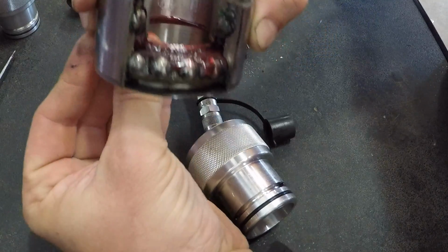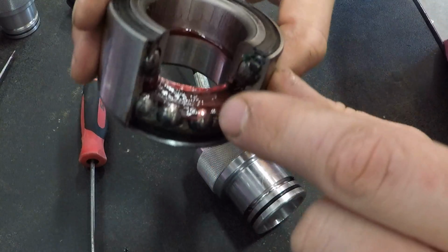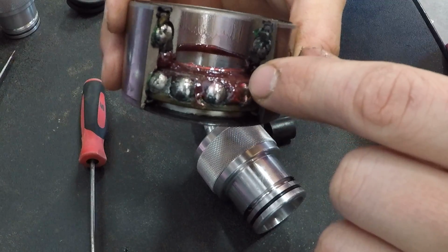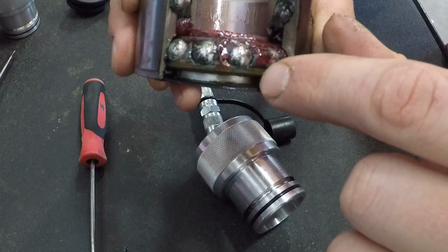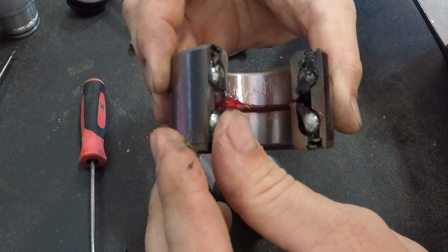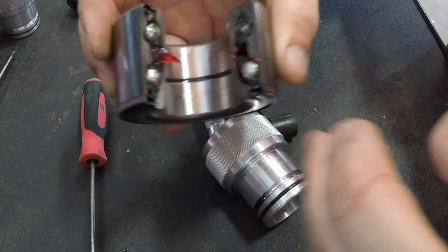That's what happens. All of the grease is in the center cavity and it's starting to go actually past the ball bearing. So in a normal bearing that hasn't been cut away, where the grease is right here that we've not touched, the grease will go through this cavity over and then come out the seal. We'll just push that back down out of the way, and that's exactly what you have right there. We can wipe that excess out so you can see the grease groove again. So there's the grease groove.